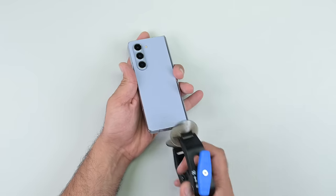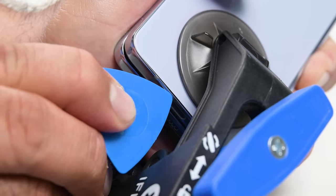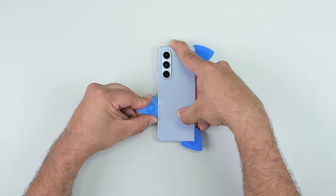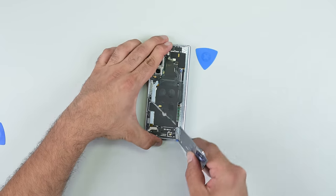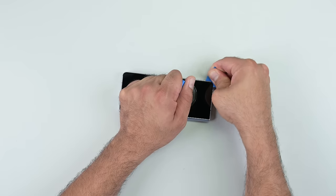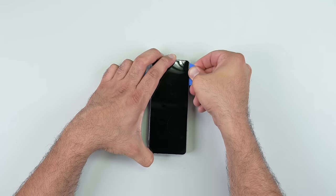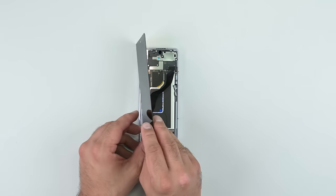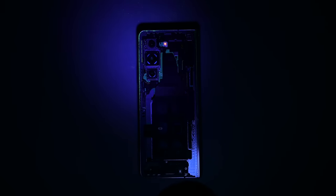Clampy's going to help us remove the back panel. Our picks lead a double life as musical instruments — they're sometimes used to dismantle guitars when they're not working on teardowns. The front panel was way harder to remove for some reason, but it came away eventually. The trick is to get the screen off without breaking it; once you figure that out, you'll have a repairable phone. Shining the UV light over the two halves shows that the glue did a good job of keeping the dust out.